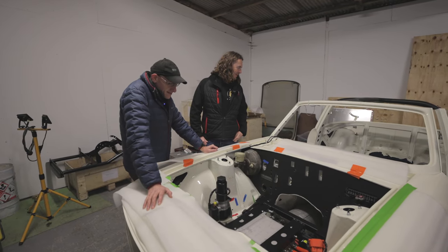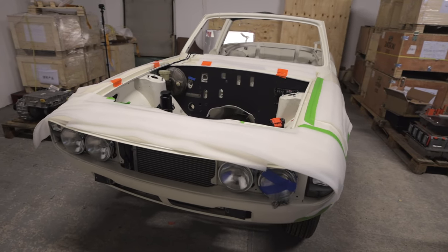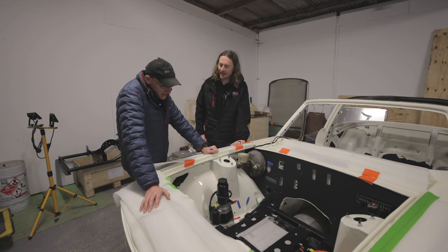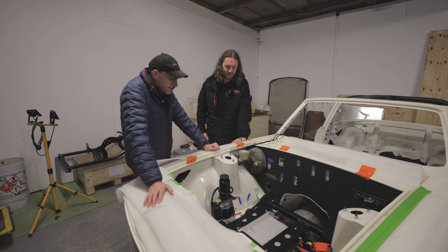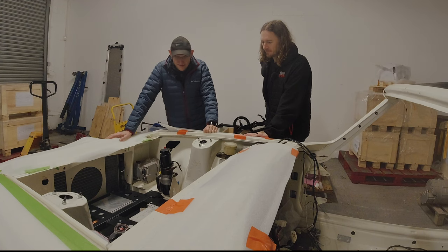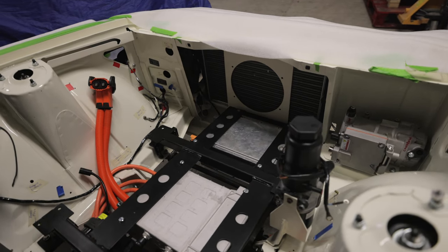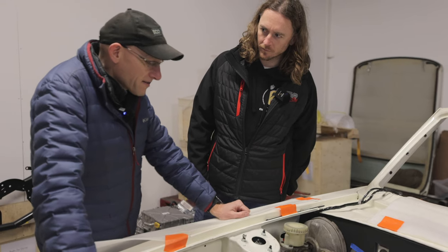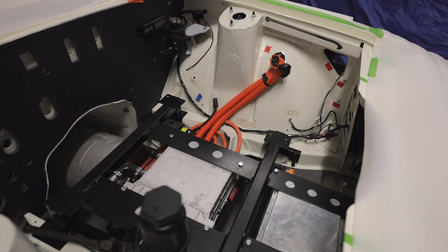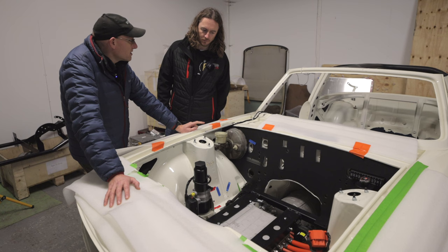This is a thing of beauty — a Stag. It's British. Well, we got rid of that bloody old V8 out of here — you never hear great things about those engines. This has gone electric and it's not going back again now. This is Leslie's car, which has featured in quite a lot of ads down at the Barnes — check out the YouTube channel. It's got a 120 kilowatt motor with a two to one reduction box, so we're getting about 600 Newton metres out of the back of this.